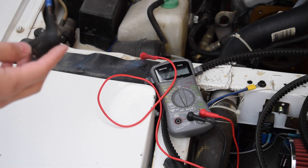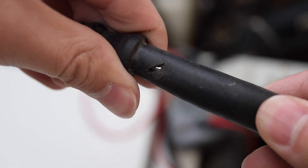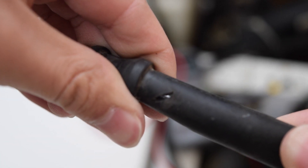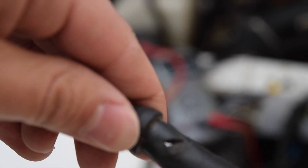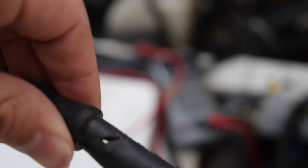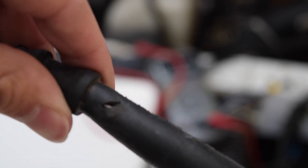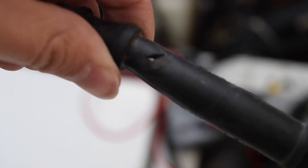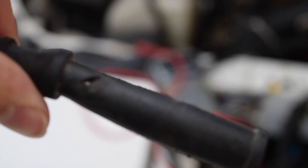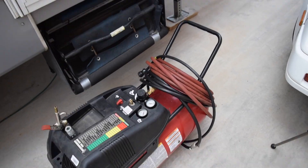As I was gearing up to test the continuity of this wire, I noticed — right here on the spark plug wire — there's actually a pretty decent gash. That is definitely not something you want to see, and this wire definitely needs to be replaced. That could be the reason we're having that misfire — it could be leaking spark. So I'm going to go ahead and pull all the other boots and check them as well. Luckily a new set is only about thirty dollars, but we want to be careful with these.